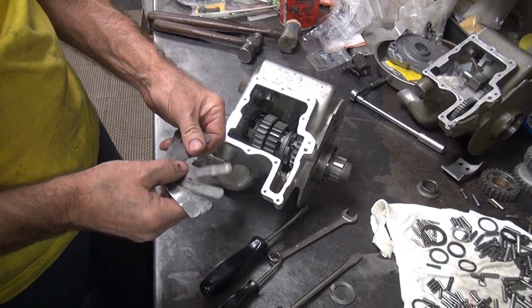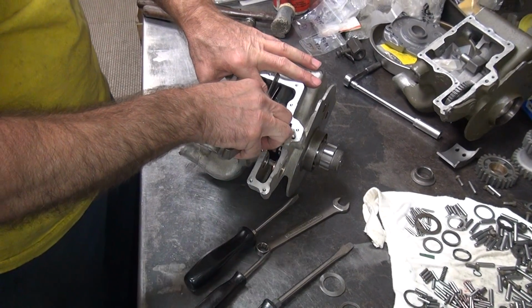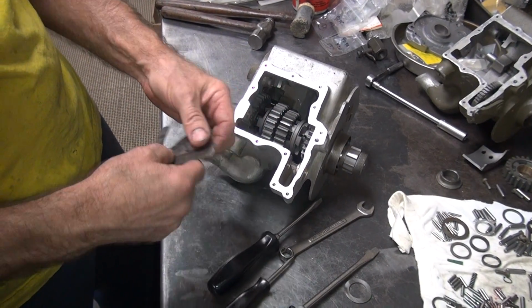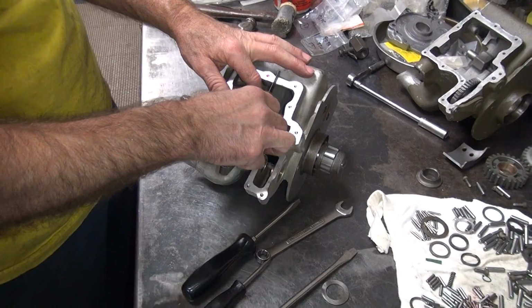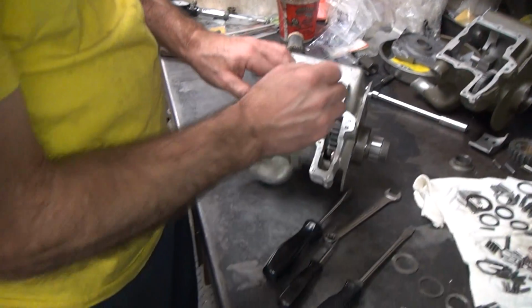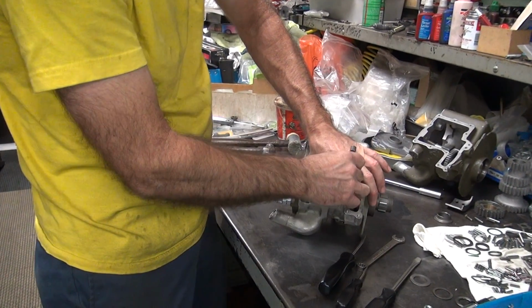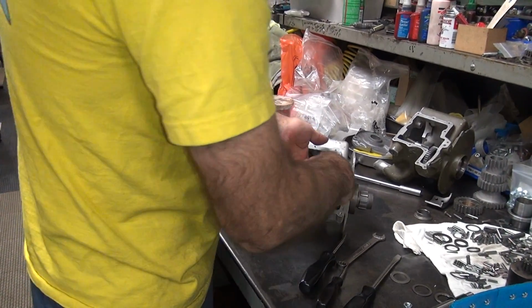It looks like I could probably tighten up about 5 thou. Oh yeah, more than that. That's 20. 22 starting to slow down. 23 has a little bit of drag on it. Now you want to try to measure it on the other side of the bracket in case we didn't grind it evenly. Right. Of course, you can't get over the other side of the bracket.